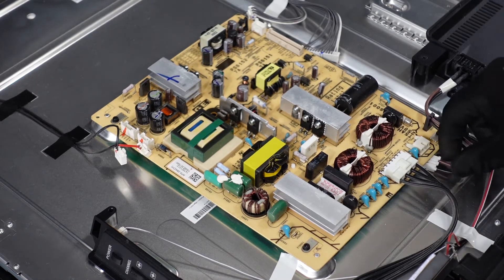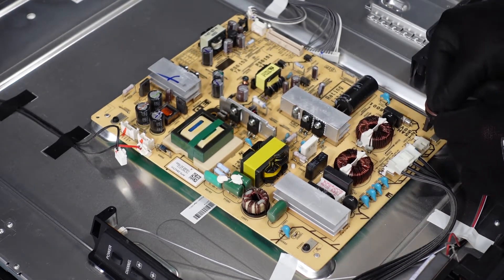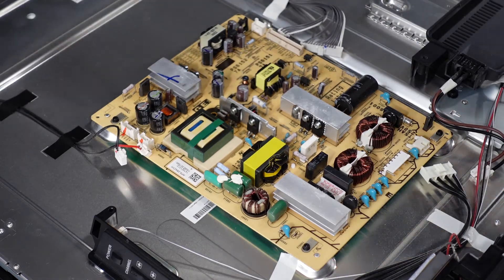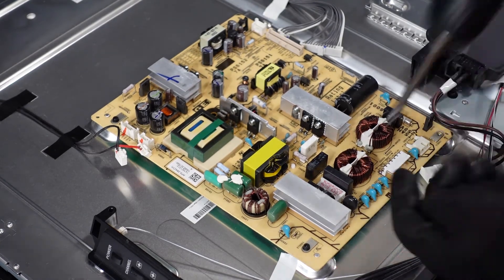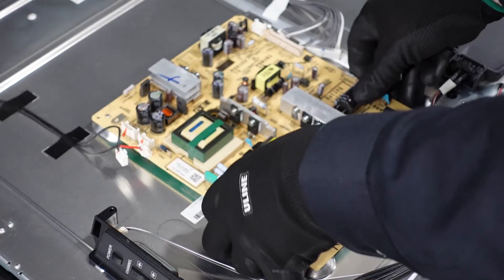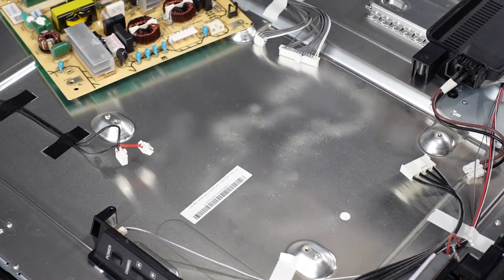Just pinch on that middle part to release the latch, same with this one — pull it straight out. If your cabling is attached to the board with a little hook, just shimmy that out of the way. You can also remove any tape around the edges. Let's get these screws out. With everything disconnected and removed, we should be able to lift up — just be gentle in case there's adhesive. It does not feel like there is, and there we go. That's our power supply.